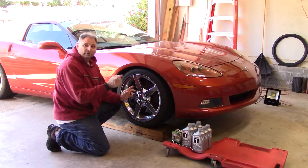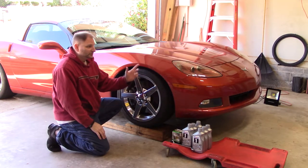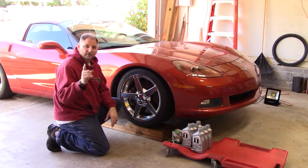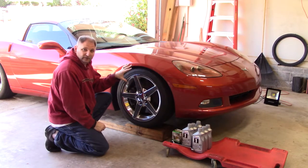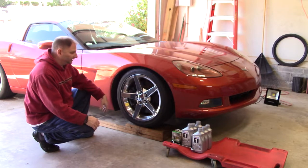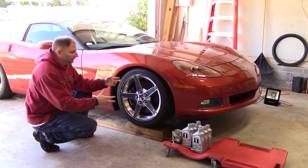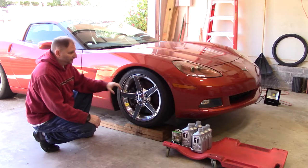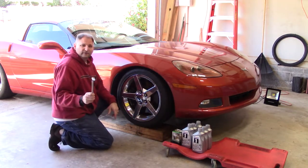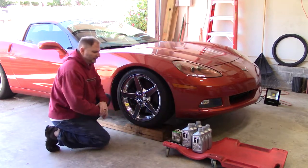I'll put a link to that. We're going to show you step-by-step how to change the oil in a C6 Corvette again, but this time we'll do it differently — I won't use my quick jack, I'll use just a jack, jack stands, that kind of thing. As always, jack stands are dangerous. Protect yourself. Don't die. You'll also need motor oil, oil filter, and I believe it's a 15 millimeter to remove the oil drain plug — but if I get that wrong, I'll put that in the description.